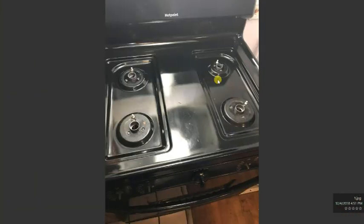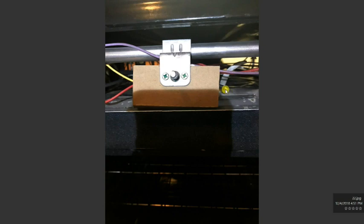This is after we put the thermostat back into place. We put the cardboard in, and then we put in the two Phillips head screws. And of course we connected the yellow wire and red wire, and you are basically done. You just put all the parts that we took out back in reverse. You can watch this video in reverse and do it step by step, seeing which part you have to install and which screws you have to install, and then you're done. That's it.